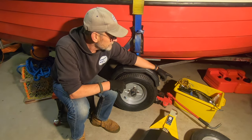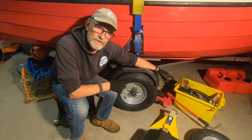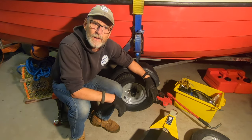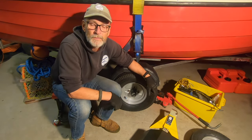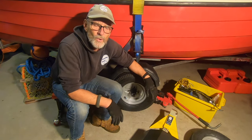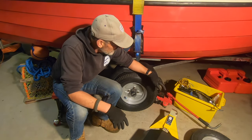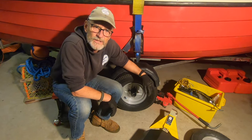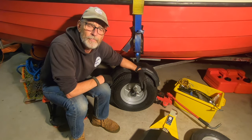The other thing I've got here is my trailer box, which goes everywhere with me whenever I'm towing. In that yellow box I've got a couple of spare hubs, several sets of bearings, castellated nuts, washers, split pins, and all the tools I need to completely refit a hub and bearings. I've got a 'what if' mentality — what if a wheel flew off? With a bottle jack I keep in the back of the car, I can jack this thing up, service or change a hub if I have a problem, and get back on the road.